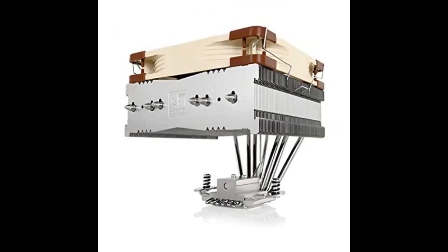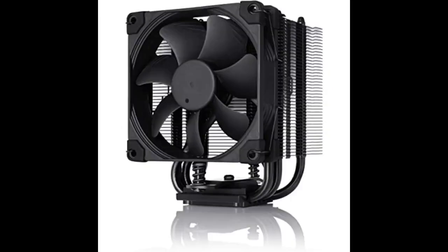The fan only maxed to 976 RPM but I never heard it during the quick test. The entire system spiked once to 95W but the CPU drew no more than 40W during the test. Anyway, you get the idea — I get the silence I always dreamed about with a chip that is in the middle of the road for heat production. This model normally runs cool even if overclocked 4GHz+.